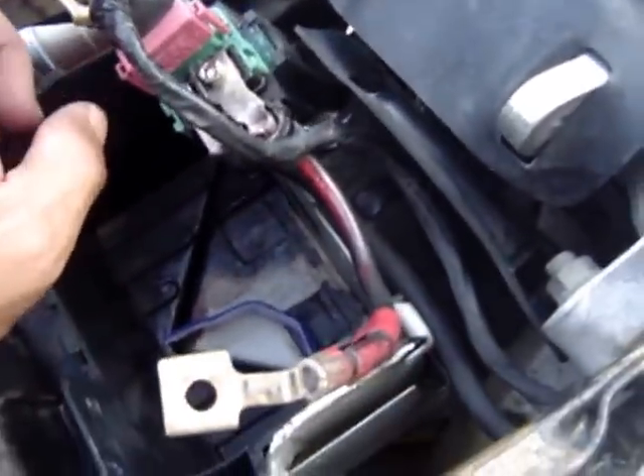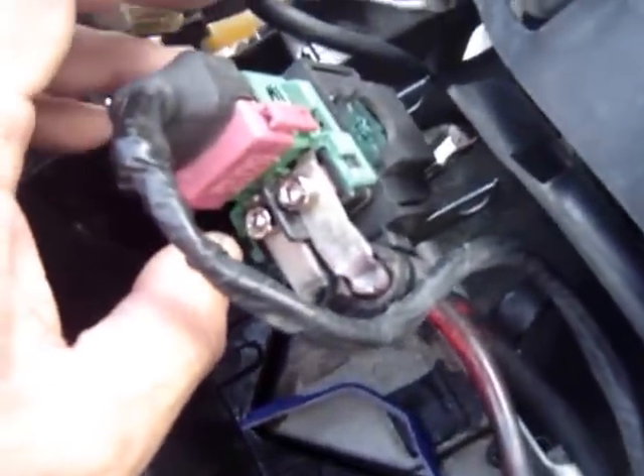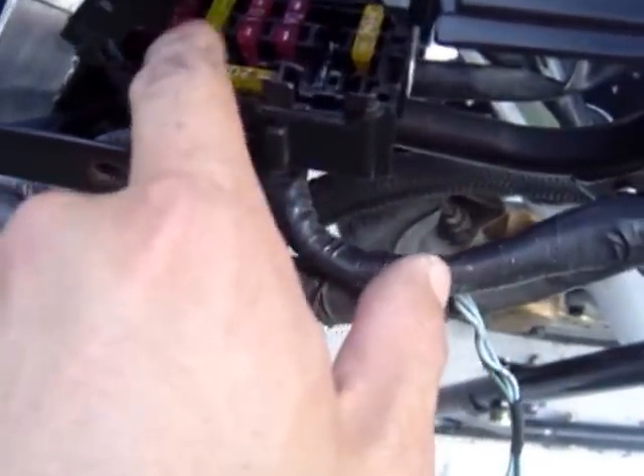From the battery it goes into your starter relay — I've already marked in and out. It's just the hot wire going in here. I've measured everything and documented everything because I'm troubleshooting the electrical. The problem was simply that the connectors were corroded, giving me irregular measurements at various points. One of my first measuring points is the fused block. The simplest way is to use a pen LED tester — clip the alligator clip on the frame and touch the pins; the LED will light up if there's 12 volts. You can go through it in probably five seconds.